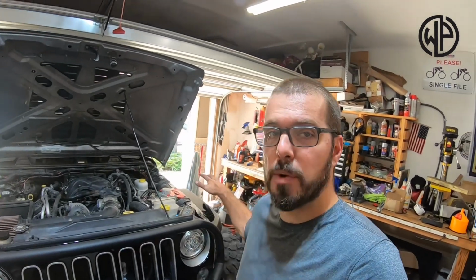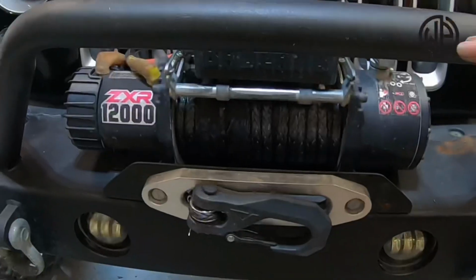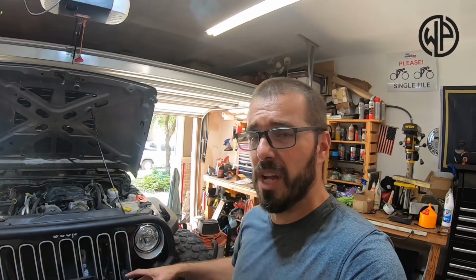Yeah! All right, guys, so there you have it. We were able to dress up the engine compartment by painting that red. We were able to get our vacuum pump up and out of the way from all the rocks and everything else that might damage it out there on the trail, and make room for a future video, because this winch pretty soon is going to be going down between the frame rails to give me a little bit more airflow through my radiator, which your engine's going to thank you for in those hot temperatures pushing big tires.